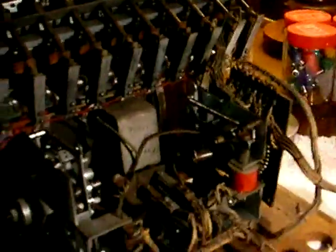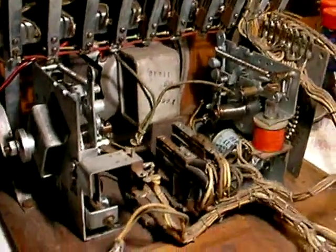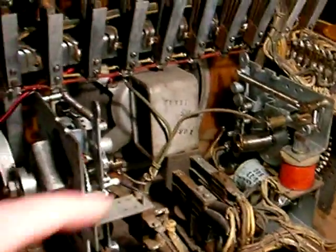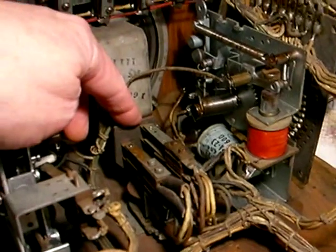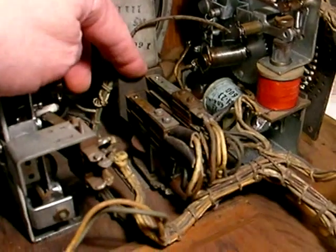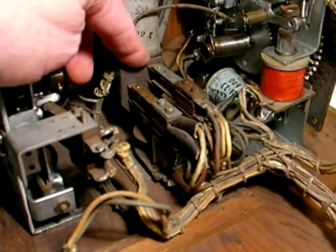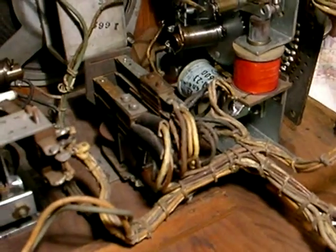When the Musicbite is plugged in and there's no coins put in the machine, it's just in standby and the cabinet lights are lit. Nothing else is happening. At that point, this relay is going to be energized. This is a common cause of confusion — people say, wow, it's energized but nothing's happening. Well, that's the way it's wired, that's the way it's supposed to be. This relay is pulled in until something happens.